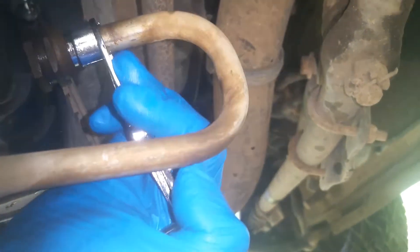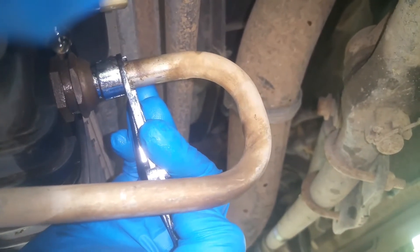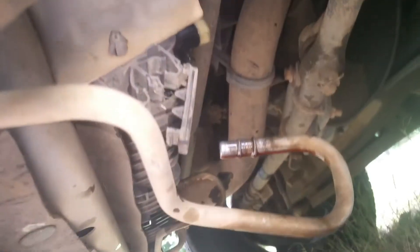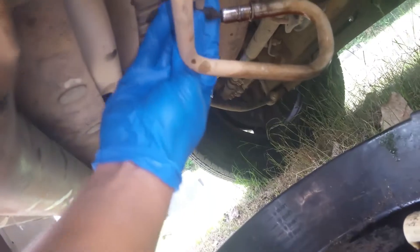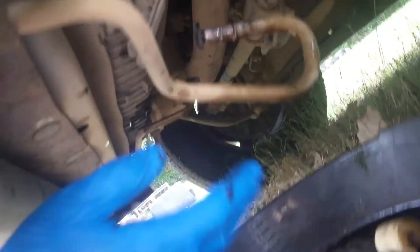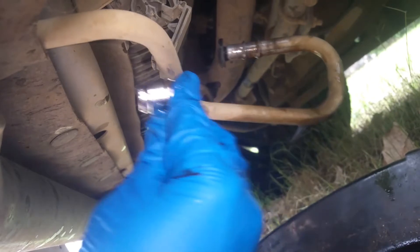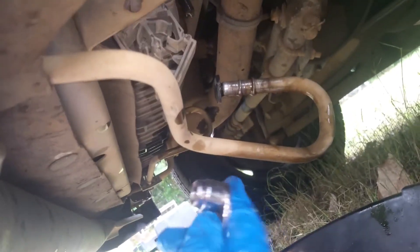I won't be able to do this one-handed, but just pushing down and pulling straight back with the other hand will pop that off of there. Make sure you've got a little drip pan there too, because it will drip a little bit. I've actually got some little rubber plugs and I'm just going to stick them in the end of this line here to keep any debris out and keep it from dripping so much. Just slip it on there and push down a little bit, and it'll pop right back and off of there.